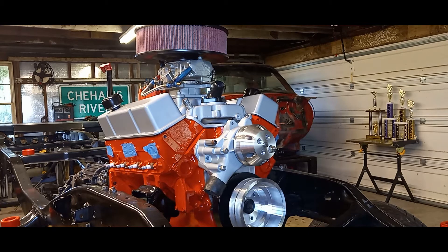This is a 383 cubic inch small block Chevy. It's got a Scat forged crank, Scat H-beam rods, Diamond forged flat top pistons. The rotating assembly has been balanced. The heads are 186 camel humps that have been fully ported — for lack of a better term. I actually hate that term, it's like when people say 'oh my engine's fully built' — what does that mean?